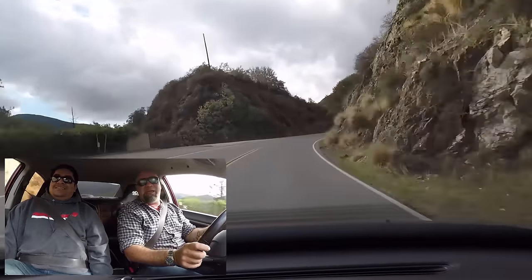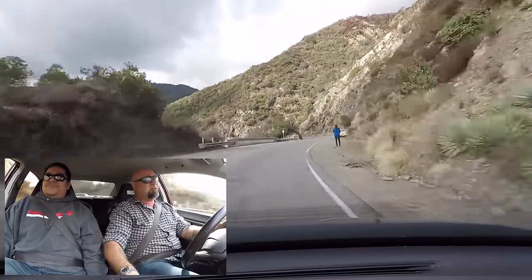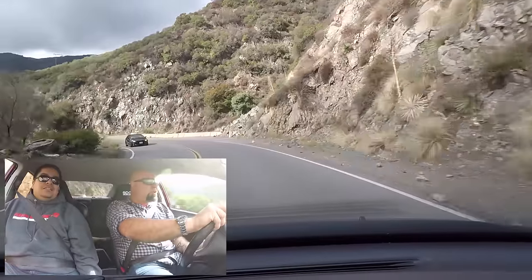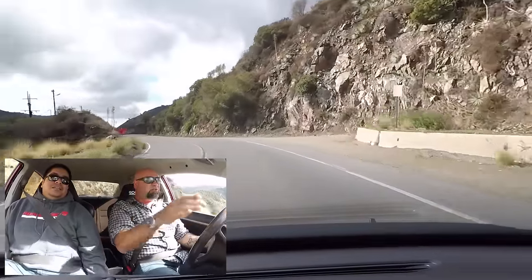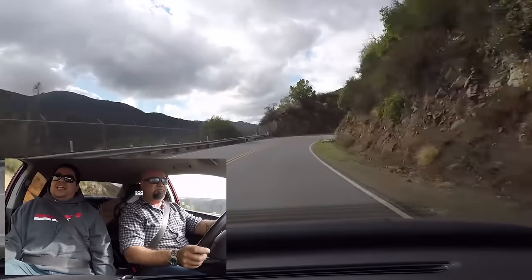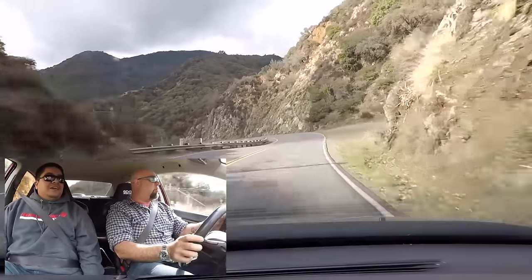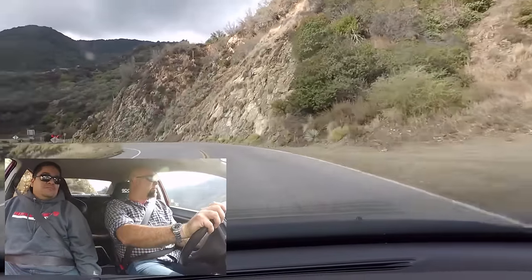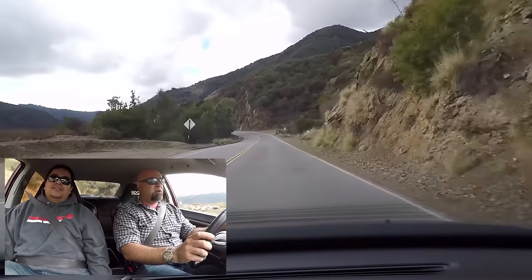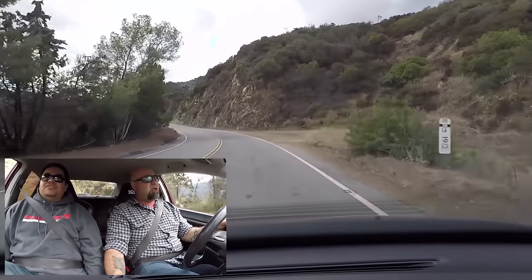And what does this weigh, 2,800 pounds or something? This car, the way it sits, is about 2,500 pounds. Oh, it doesn't feel like anything. What have you done with your suspension? Because your steering is really, really good on center as well. It's got some HPD bushings in the steering rack. Is that it? That's it, yeah. No way. But it's got a Godspeed suspension, which is just coilover? Pretty standard, yeah. Oh, it's got spherical bushings in the A-arms.